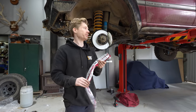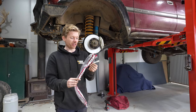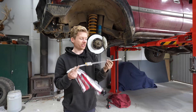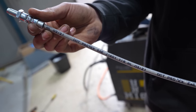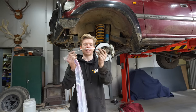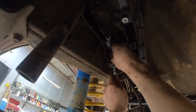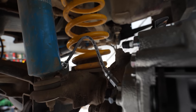Now we're installing some new brake lines. As much as these are currently okay, they are slowly wearing out - I don't think they've ever been changed. These are from Protex - their braided brake lines, which are actually a bit extended to suit my two-inch lift. We've also got ones from the brake back to the axle as well. The reason you'd choose a braided brake line over standard factory rubber lines: one, these are more resistant to wear and tear, especially driving off-road through scrub. Punctures for rubber brake lines are common. Having braided means more toughness and you're less likely to get leaks, cracks, or wear and tear. Secondly, they don't swell under heat and pressure like rubber can, especially when doing longer distance hosing for a big lift. They are a little more expensive, but for a vehicle this old and what it's going to be doing, braided is a good option.